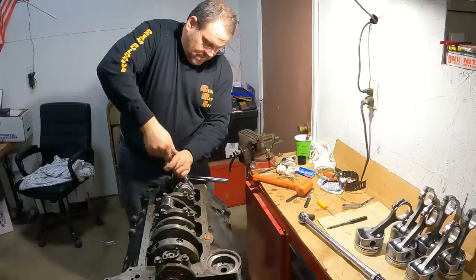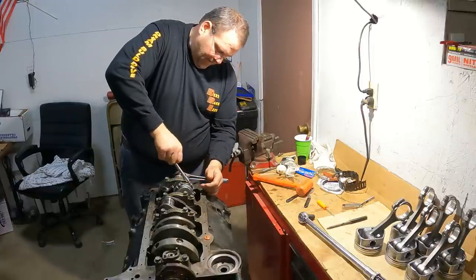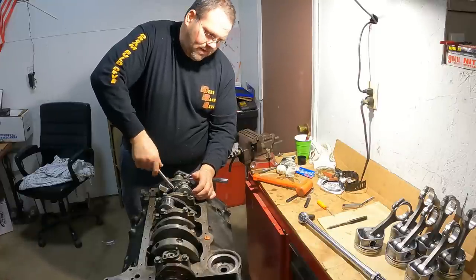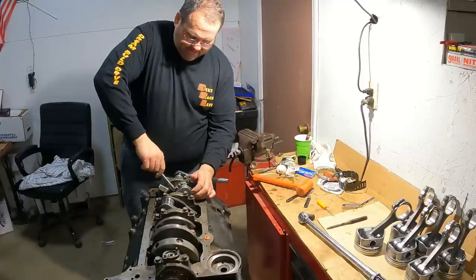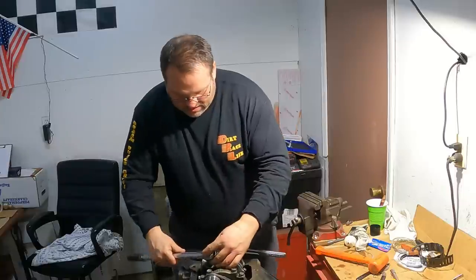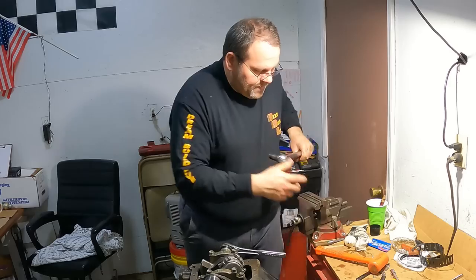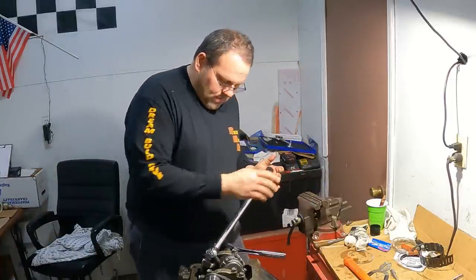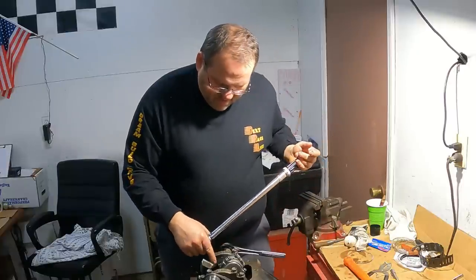That is coming together quickly. Do not use an impact wrench doing this. It's okay to take stuff apart with an impact, but don't put it together with an impact, y'all. Don't even run bolts down with an impact, because you can accidentally bump on them and you can hit way over torque really quick. Okay, so now I'm just gonna give it a little bit snug, all right, bump. Just my habits. I'm already set. Coming up about halfway. All right, so I've come up halfway on this one.